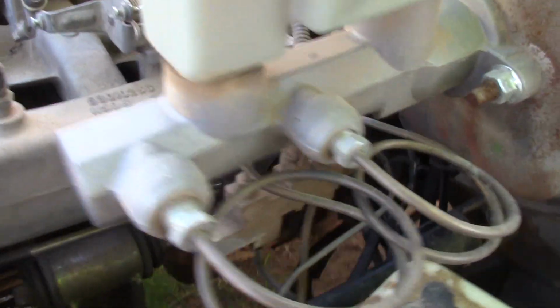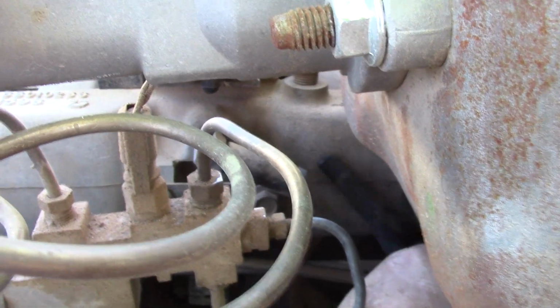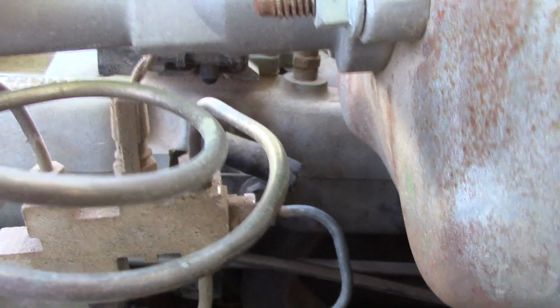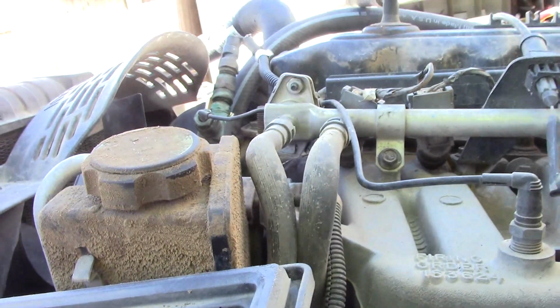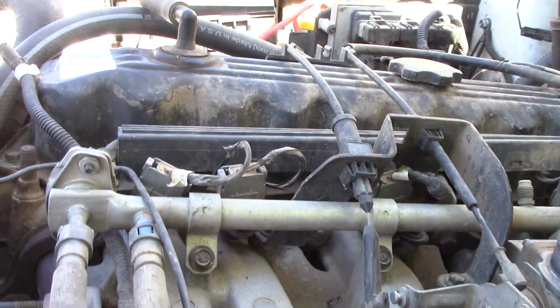Now the other thing I'll point out is just look for things that don't seem right as you go. I found out a little bit ago that this just basically pulled out with no effort at all, so that might have actually been a vacuum leak. And since this is a later model transplant into an earlier Jeep, this is all going to the original canister, which is down here. So there's some modifications, but it might not have been holding pressure, and when it is due for emissions again, February of next year, so I've got about a year to go, it might have failed because the tank would not have pressurized. So I'll be using a little silicone or something on that to make sure that it works the way it's supposed to. So this gives you the opportunity to find different things going on with your vehicle as you go and fix them. And believe me, if you take on a project like this, you're going to find lots of stuff that you didn't know was broken.